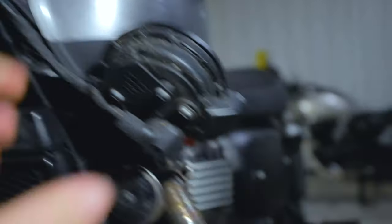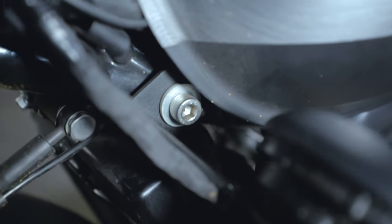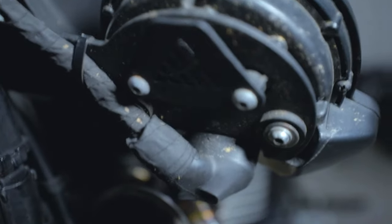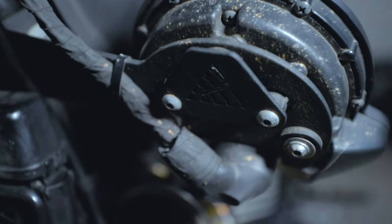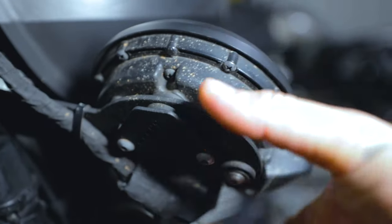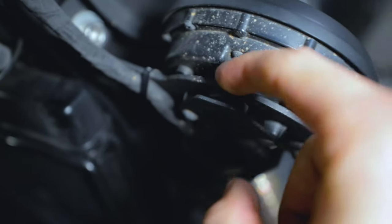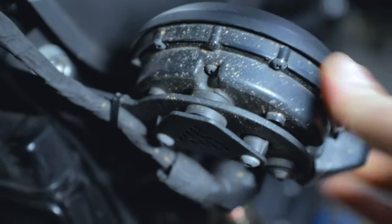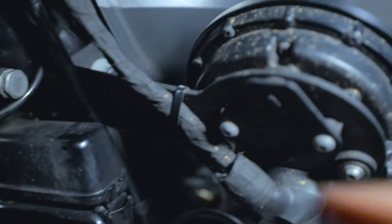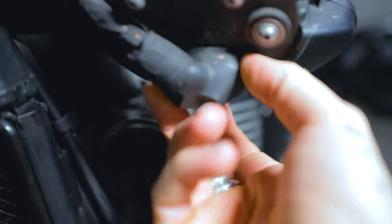You can see how dirty it is — it does cop a lot, and you can't have the back cover on still, which is a little bit annoying. They do give you this plate — that's the bracket there — and they give you that massive bolt as well. It's like a part of the frame; you just take the old one out and stick that one in and it's all nice and tight. It's not too much of a pain to actually mount the bracket up with the gauge itself. You just use the original screws, along with that little backing plate there — just to stop thieves, I guess. The gauge basically just mounts straight in, and you use the rubber grommets that come with your gauge anyway — stick it in there, stop all the vibration. I'd like to have that rear cover on still just to protect it from all this dust. I just stuck a cable tie there to stop it from jiggling around and loosening up at the plug, but I've never had an issue with it.